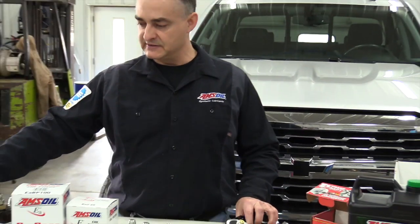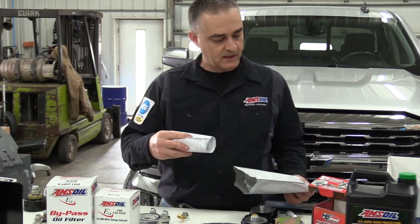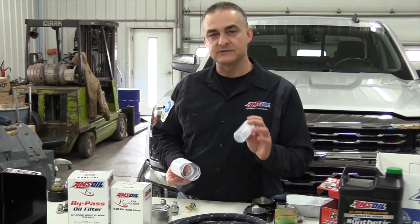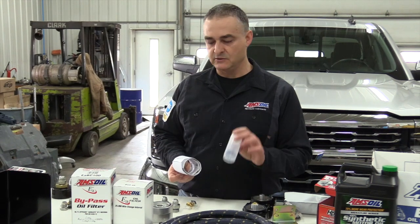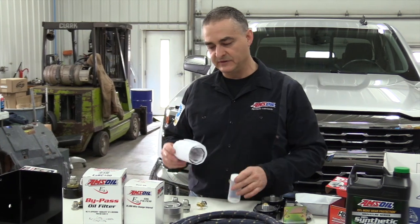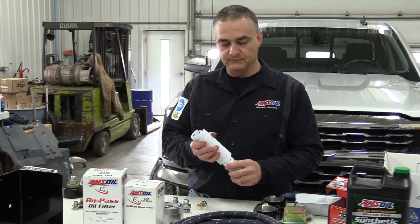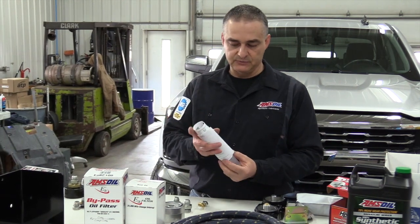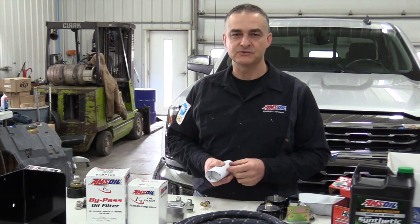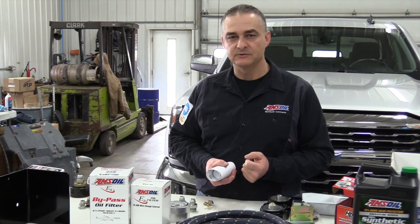The other thing you're going to want is oil analysis kits. AMSOIL handles kits from Polaris Labs — it's an independent lab; AMSOIL doesn't do the testing. You can buy these kits through AMSOIL through your wholesale account. It's basically a sample bottle. Once you get your engine up to temp, fill it up to the fill line, fill out the paperwork, drop it in the mail, and they'll email you back results usually in three to five days. I highly recommend doing the oil analysis — it's the checks and balances to be sure everything's working as it should. If there's something going wrong inside the engine, a lot of times you can pick it up with that oil analysis.